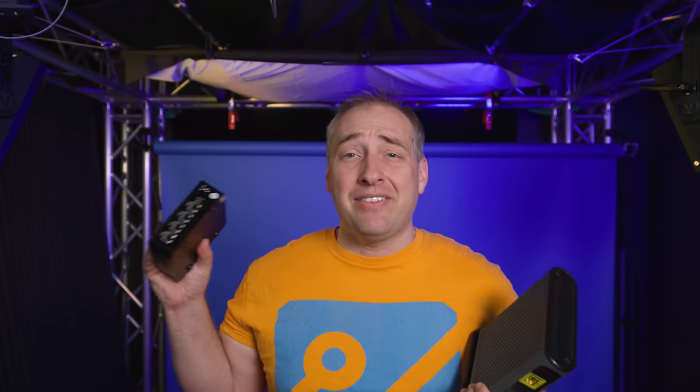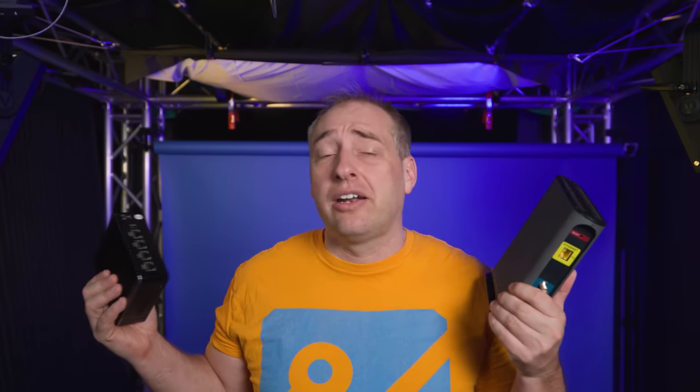Let's talk about site-to-site VPNs. A lot of people don't necessarily need them, but it's nice to be able to have all your traffic encrypted or access something remotely in a data center. There's also OPNsense, MikroTik RouterOS, and a number of different packages — both paid and open source — that give you way better tooling and the ability to do things you frankly can't do on a relatively locked ISP box. And having something with two and a half gig ethernet to match a modem's two and a half gig ethernet port is actually valuable. It's PFSense, so you also have a real firewall and all that good stuff.